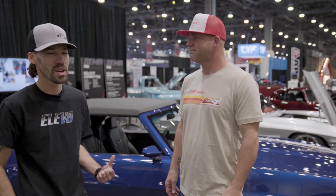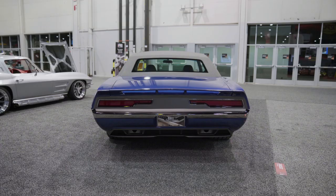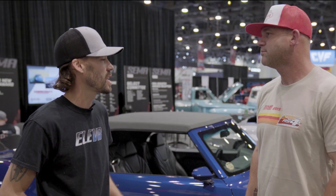Tell us about your Camaro. Yeah, we got a 69 Camaro here, convertible. We did a little something different — you'll notice on the top, it's actually a removable hardtop, all built out of aluminum. I try to keep it so that when the top is off, there's nothing sticking up above the belt line of the car. The owner wanted it to be sleek when the top is off. We reshaped the roof line so it's got the coupe side glass, giving it more of that sleek look — it still looks like it has the rag top look when the top's on. The car's widened in the back three inches, tapering back from the doors.